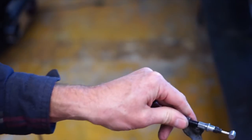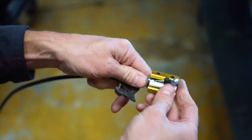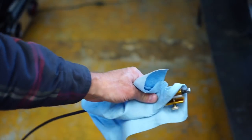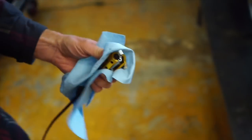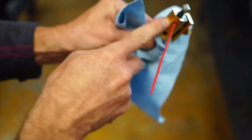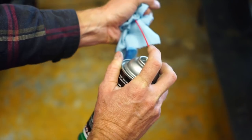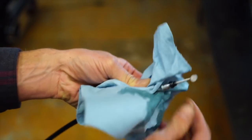Not everybody's going to have one of these, but this is called a power luber. See that little rubber seal — pull that off, then just clamp this down and you've got a sealed unit. Grab a rag and cable lube — we have this on our website. There's a hose that goes to the can. When I spray compressed lube through here, it'll go down the cable on this brand new dry cable. I'll get a little bit of leakage. Do that and then put this little cap over the top and clean it all up.